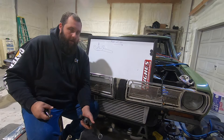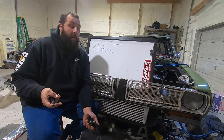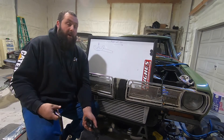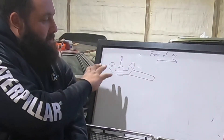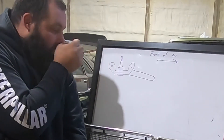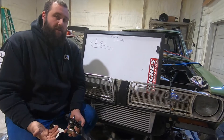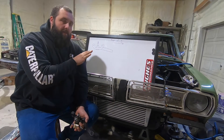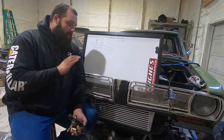This isn't like a normal backyard build — not very many people do this type of front steering setup. I wanted to publish what I found. I was originally planning on possibly making a set or publishing the measurements so somebody could build them or have them contracted. I was going to have it machined out of one solid piece with a serviceable, removable ball joint pressed in and out. But unfortunately the machine shop waited a month and a half to tell me they didn't want to do the job. So now I'm even further behind and I'm going to throw something together, because the stock K-member on this car is a band-aid for right now — eventually this car will be a strut front-end car.